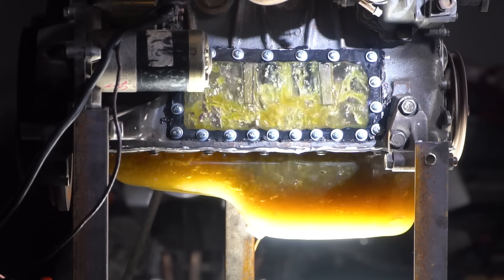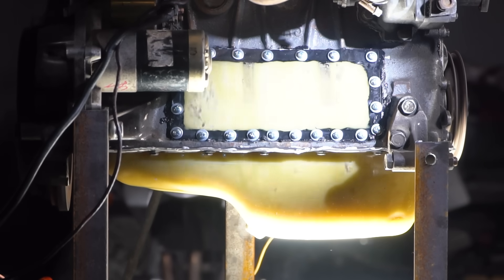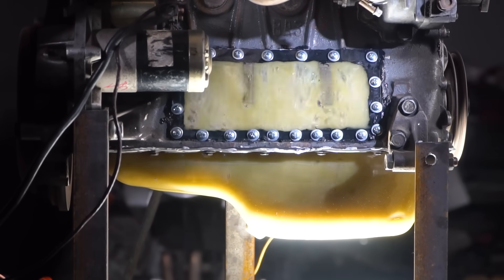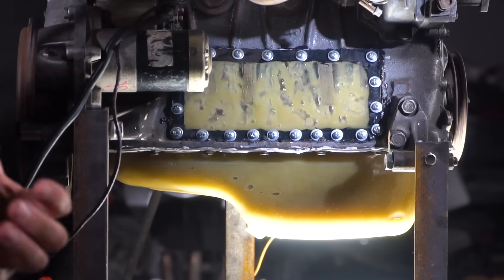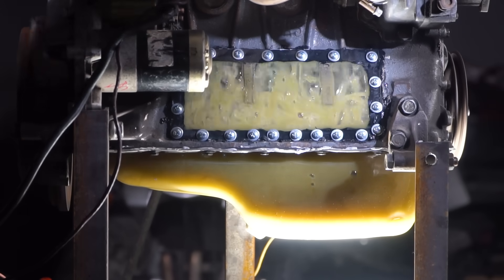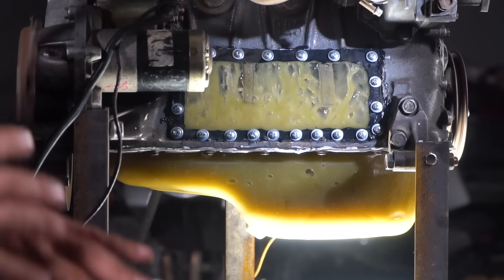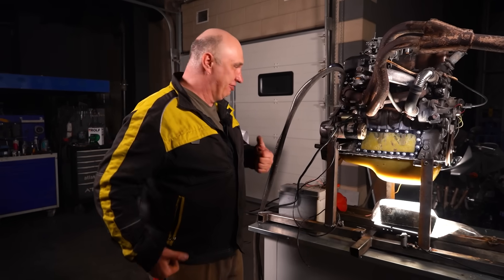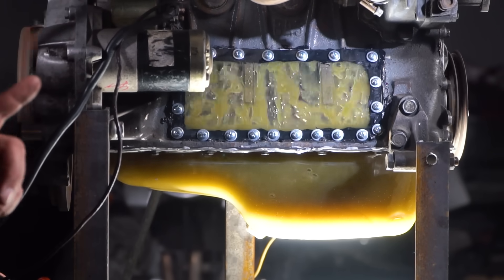Let's bring the revs up. We see way more foam forming and more oil splashing onto the engine block. The crank can no longer blow the oil away — instead it's picking up a ton of oil and throwing it around. As a result we can't really see anything; at the very least we can see it splashing around. You'll notice that engine operation has become somewhat less stable at idle.